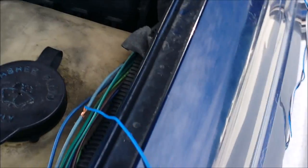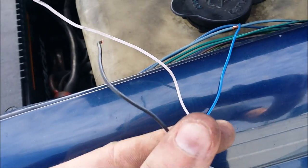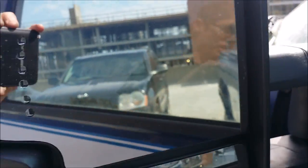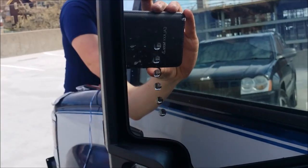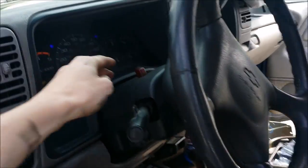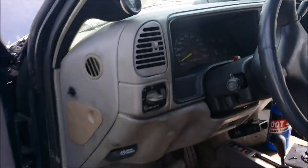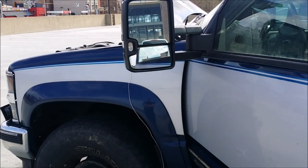All your wires that go to the turn signals come up through this wire loom. For your turn signal, this light blue wire is your positive and then you'll just ground your black wire somewhere else. Let me show you real quick that it's working — I'm going to turn my hazards on. You hold that to ground and you can see it going right there. That's all you do for that first step.